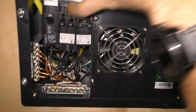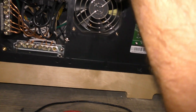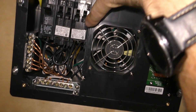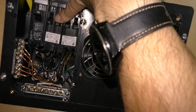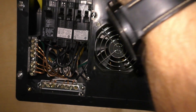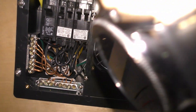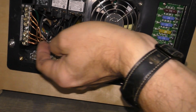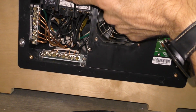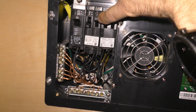For the converter, the yellow cap in there was hooked to the outlets, and they went together on the same circuit breaker. I temporarily moved the outlets over to the circuit breaker with the hot water heater on it, so that I could turn the converter off with the circuit breaker when I want to use the inverter — until I get an automated system set up where I can tap the line going to the converter, turn it off manually, and put the outlet back on the number one circuit breaker. That's how I'm going to do it for now.